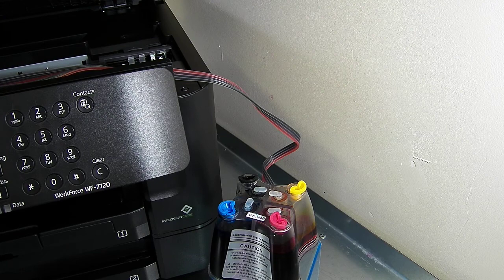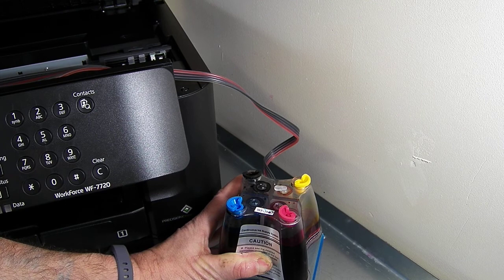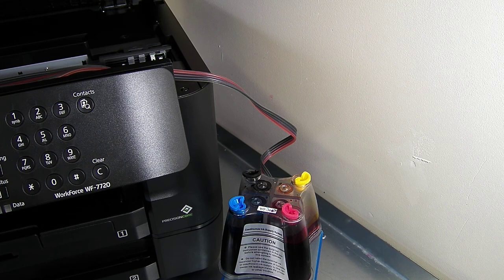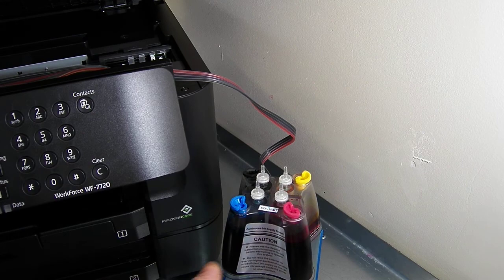You need to have the four small flat plugs removed. Again, that's quite important. If that's not done, it can cause the printer to starve itself of ink, clog, damage itself, burn out, number of issues. So we do recommend make sure that the air filters are fitted during install and after when you're using.